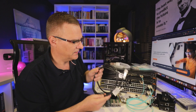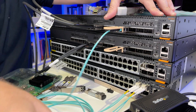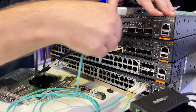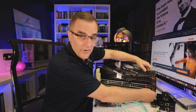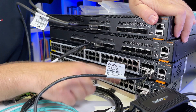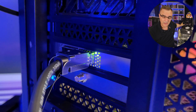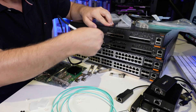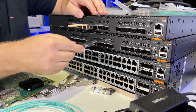I've also got a 50 gig DAC cable. I could run 50 gig directly between the two switches. Let me pull these out to make some space. Rather than using the breakout approach, I could run 50 gig directly between the two switches using this 50 gig DAC cable. What I demonstrated in my previous video is 100 gig on the Mellanox connections on these PCs using DAC cables to these 8360 switches. I could run 100 gig like that, or if I preferred, I could use fiber rather than copper — putting MPO connections into both switches.